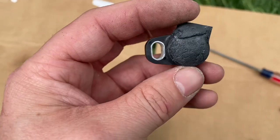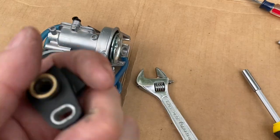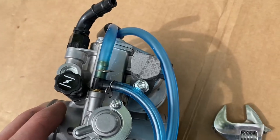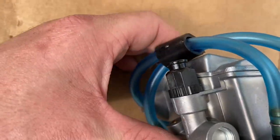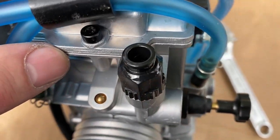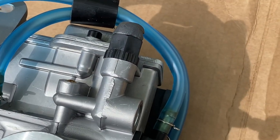I'm going to bring this back and grind this down since it takes an hour for the JB Weld to cure. That's how it looks right there. Now remember the hot start - what I do is you just pull that off, clean it off, and I'm just going to take a little bit of JB Weld just like I did before and fill that up. Just going to let it harden. Should be all set when I go to put the carburetor on the quad.